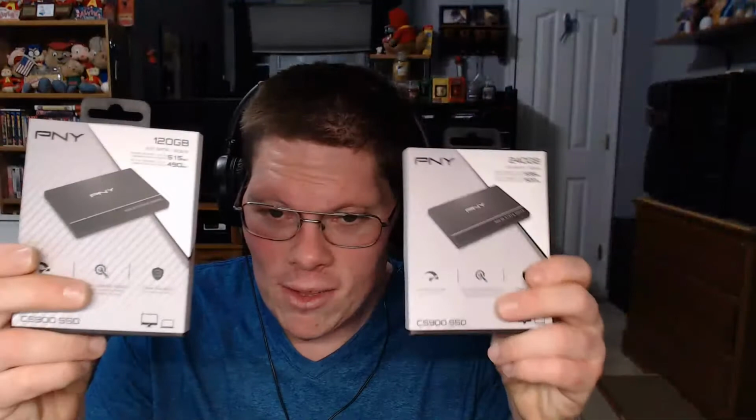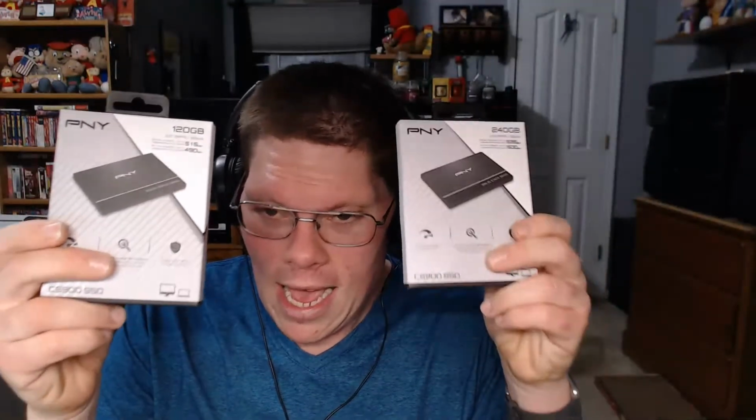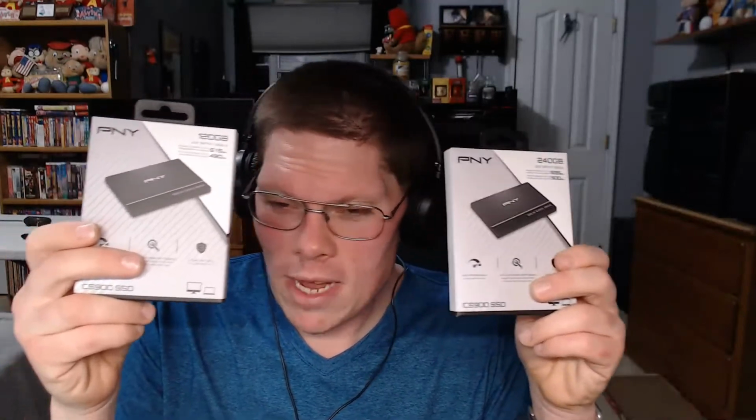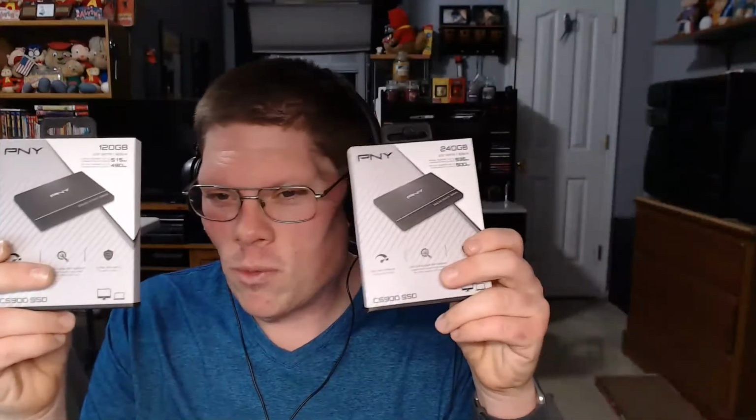And I will tell you that they're pretty darn close to that. As a matter of fact, I tested both of these with Crystal Disk Mark, and they both got about the same. I was getting about 520 reads, and writes were about the 460, maybe 480 mark. So pretty darn close to what they're boasting here. And these are very reliable SSDs. I've been using the PNY CS900 series for about a year, about as long as they've been out, and I've not had one come back bad yet.